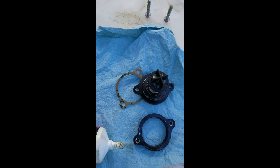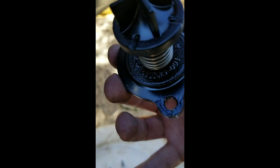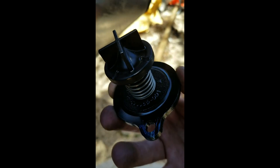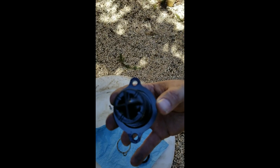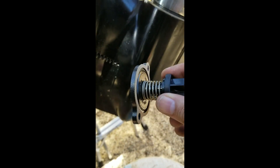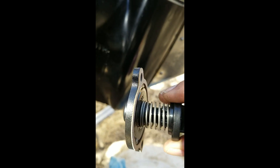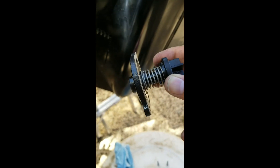Here's my assembly — there's the gasket, the cover, my screws with a little grease on them, and I'm going to put it together. One of the things I do with the assembly is put a little grease just by those bolt holes — just a tad. The reason I do that is when I put the gasket on I want it to stay in place and not move around as I try to manipulate it back into that hole. If you put a little bit of grease on there and then lay that gasket on top, it won't move as much — it's like a little sticky glue. The gasket would normally fall off, but the grease holds it so it helps me move the assembly without the gasket shifting.